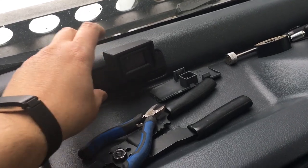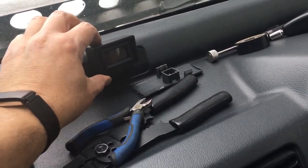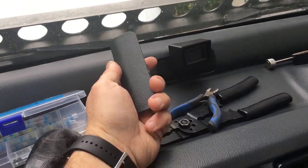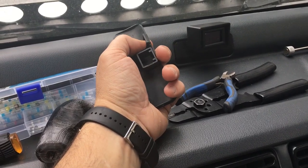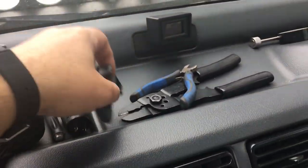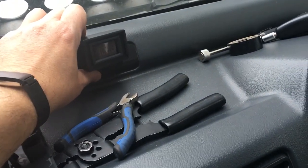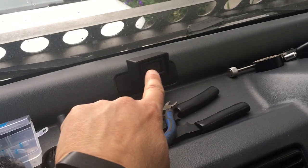The little tiny cluster is installed. It's a little loose so it's going to vibrate. I'm going to wrap some electrical tape around the tabs — this was my first attempt at the 3D design and I wasn't aggressive enough with the bottom tabs. One of the bottom tabs was already broken on mine. Wrapping electrical tape on the bottom tabs should give me the little bit of tolerance I need — looks like about a sixteenth of an inch of allowance. But in any case, that's wired up.